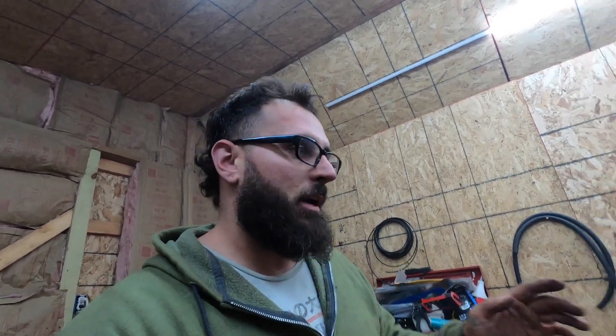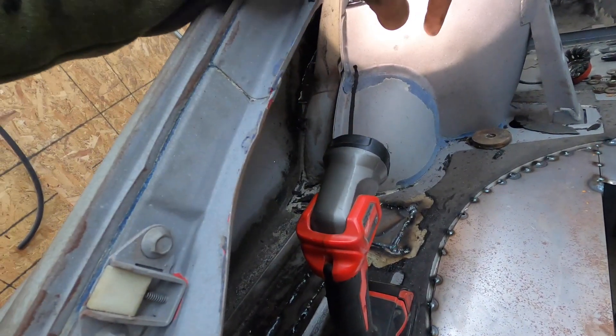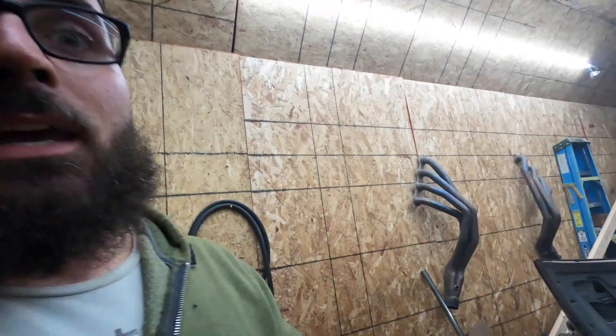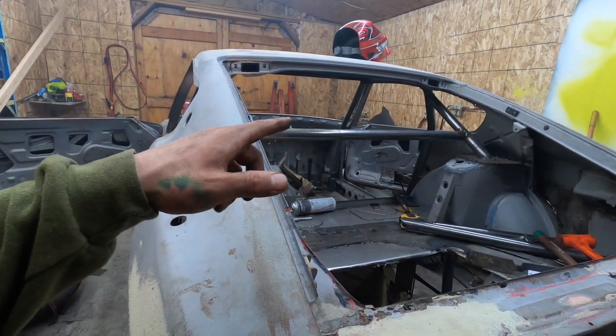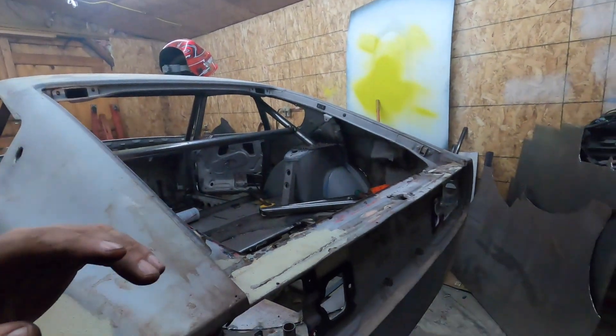When we come in next time, we'll finish up the welding on the roll cage, touch up a couple more things on the fuel cell. We got the bad metal out from under here — we just have to replace that frame rail with some angle iron — and then we're going to focus on the wheel wells, getting those finished and tidying up any little patch welding. Most of the rust repair is complete except I am waiting on the sill, and I'm probably going to pull the hatch in here soon because I cannot for the life of me find anyone that makes a fiberglass hatch. I'd spend upwards of $800 just to get a nice decent one — even in carbon fiber. If you guys know any companies that make fiberglass hatches for Z's, let me know and send me a link.